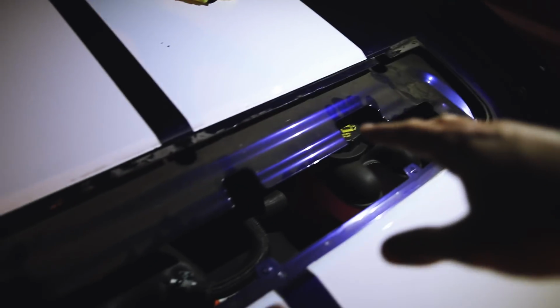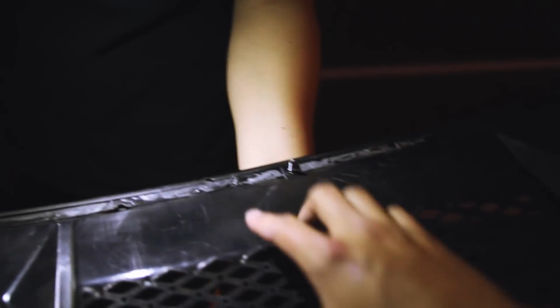We got the hood vent off. It's all just 3M taped all along this edge right here, so you do have to pry it up. Be careful, don't push against your hood too much. We will clean it up, take off the old one, and we'll apply a new little piece all along here on the new carbon. Stock piece, as you can see, this is the 3M, so pretty easy. These little lips, they kind of slip right in and then pops in.